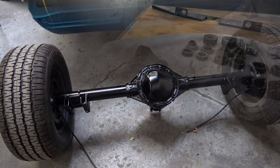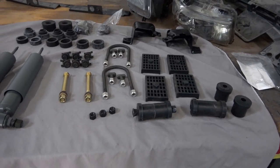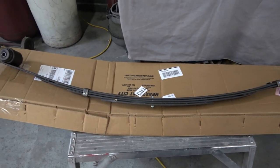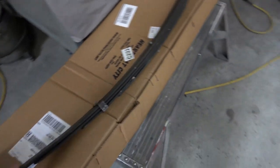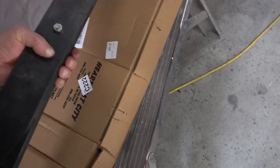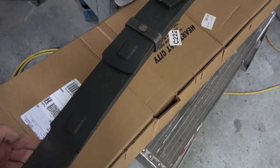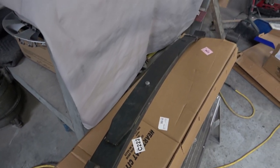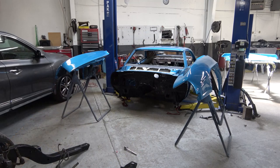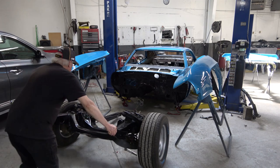Like the front suspension, when I get it back to my own shop I'll rebuild the brakes and restore all of those. Here are all the new parts I have to install in the rear end. The car came from the factory with five leaf springs, but Z28s are only supposed to have four — those leaf springs don't look like they've ever been off the car, so who knows. I'm putting a brand new set of the correct Z28 four-leaf springs back on the car to make it correct. I got these from Heartbeat City, which makes perfect reproductions — very happy with those.